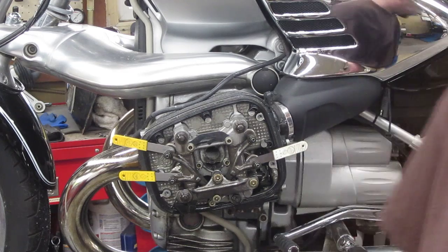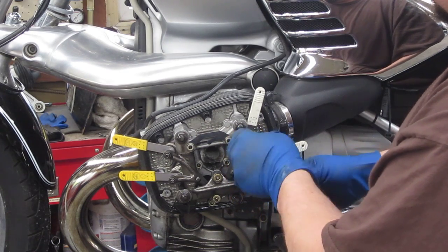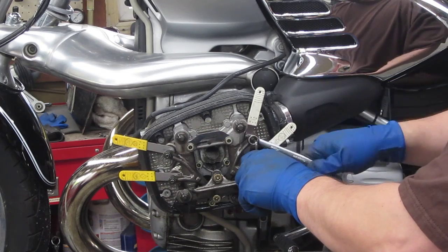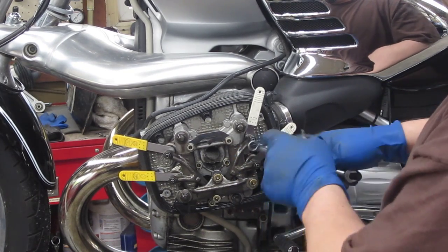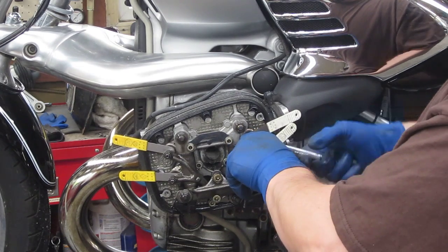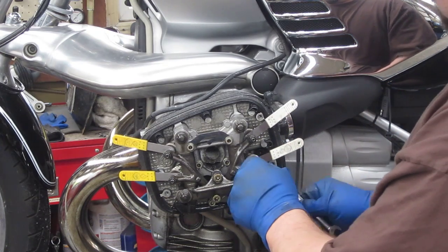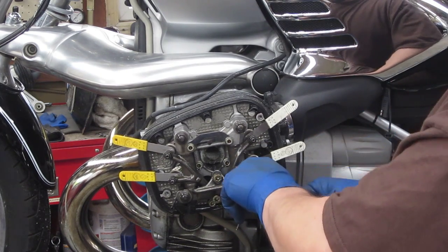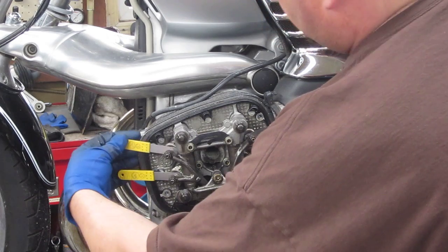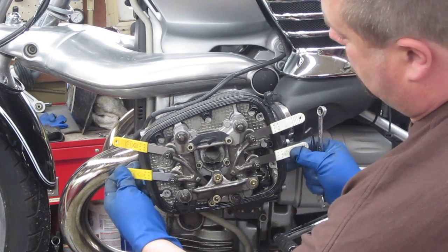So what we're going to do is tighten that one — you'll probably see the exhaust fall out. Just loosen, turn the Allen slightly, snug the nut back down. These nuts don't take much torque, it's like 8 Nm, just next to nothing — just snug it, it doesn't need a lot. Okay, that one's a little bit tight, but that's going to change when I snug this one up, because this one has a little too much clearance. All four now feel the same — you have a good comparison — and that's it.